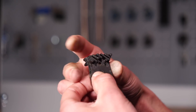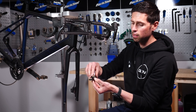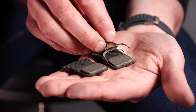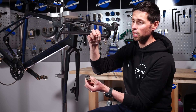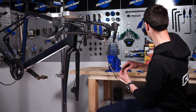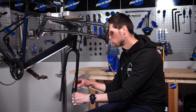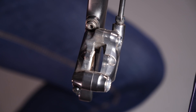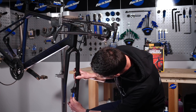You can see on the side there's a left and a right pad — the same will be on the new pads. I'm not going to replace these because they've got plenty of brake pad material left. Taking it apart, you can see one brake pad and a little spring that sits in between and helps hold the pads away from the rotor when sat in the caliper. Nearly all disc brake pads when bought new come with a new spring. If they don't, you can reuse the old one — there's no problem whatsoever. We can also check that there's no damage or oil seeping from the caliper seals.